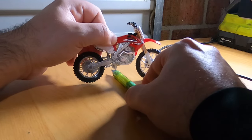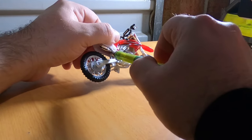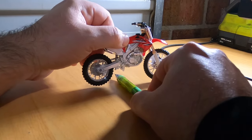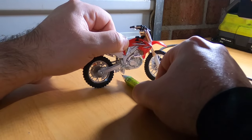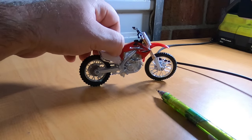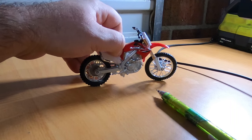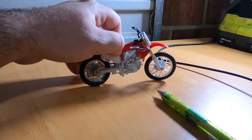Having said that, you would think that if you tighten up the preload you'll feel more of the bumps, because the spring is tighter and it's got a lot more force on it. But what people don't understand is, when you actually sit on the bike you're preloading the suspension — and you're preloading it more than what the preload value is, most of the time.